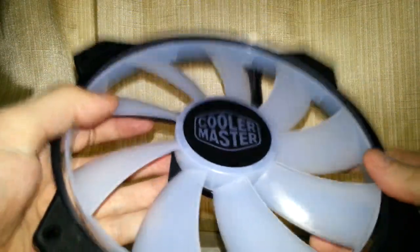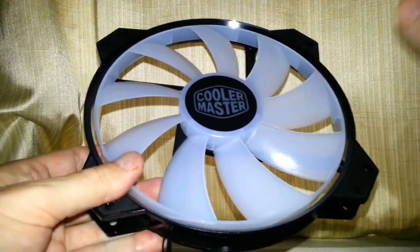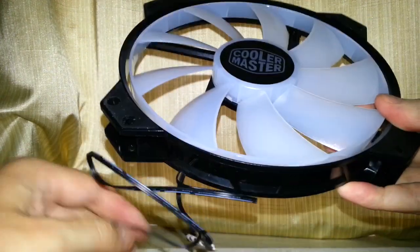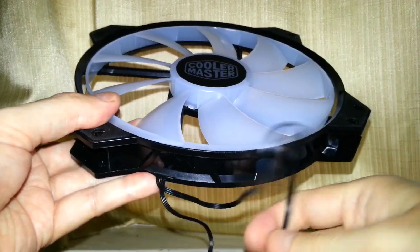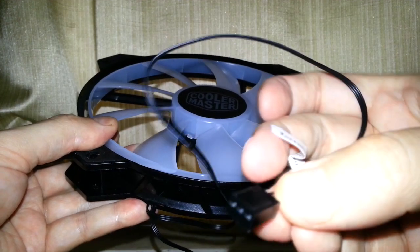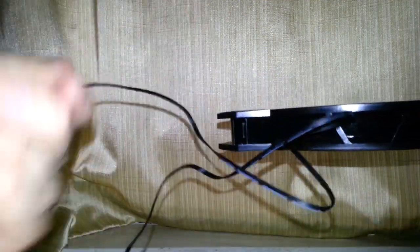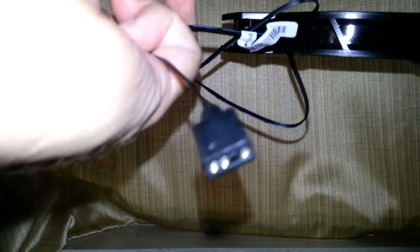Here's the fan. It's quite a quality fan actually — hopefully for that price it wants to be. I'll be happy to pay a good price if it's going to last. You can use this without the RGB — you don't need the RGB on. The fan power connector is three-pin, which goes into your motherboard — not four-pin like the other one. That controls the speed on the motherboard and has nothing to do with the RGB.